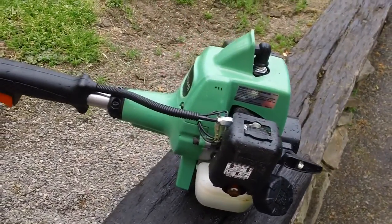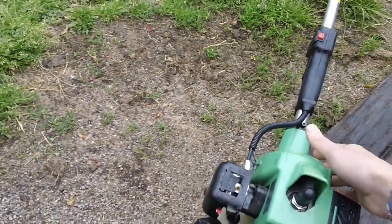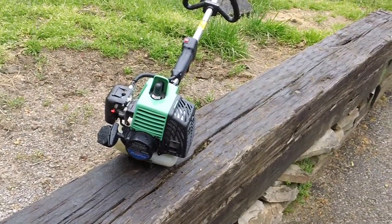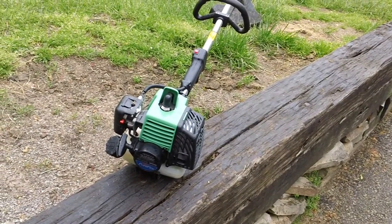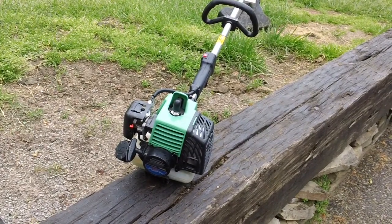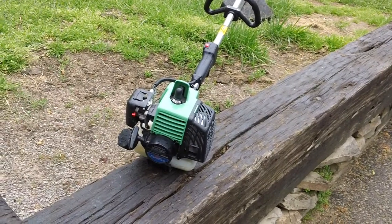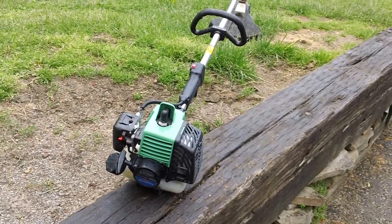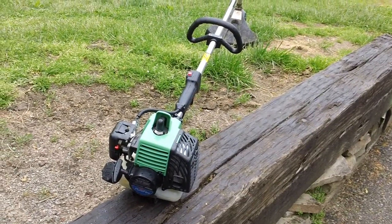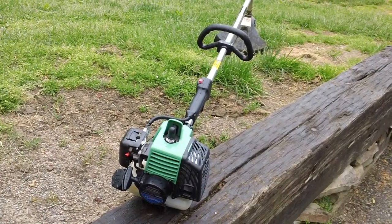And I'll even start the thing up for you, because the guy brought it over here. He was an older gentleman, and he was originally claiming that it basically would not start. We took a look at it and tried to flood the engine because the spark plug was all carboned up, even though the cylinder looks fine. This one has about 140 psi. I couldn't believe it myself, but it definitely had a lot of compression in it. So that definitely was not the problem, because if your cylinder is scored up, you only have maybe 60 psi in the engine, and it's not going to fire whether you try to start with ether or not.